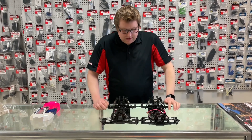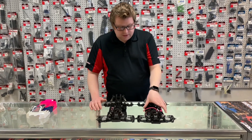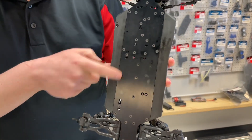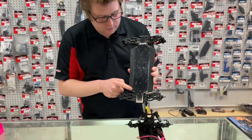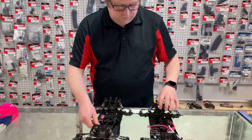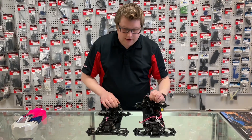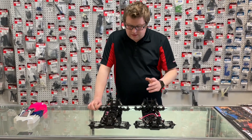Other things that change with that chassis: now you're going to have a multitude of different positions to move your battery forward or backwards. On this car there are three positions in the front and four in the back. If you run a different style shorty and need to pinch it in, you can do that. On the old car there was zero positions of movement. This one also has four different o-rings you can put on the rear post, which changes how much play you have between batteries.